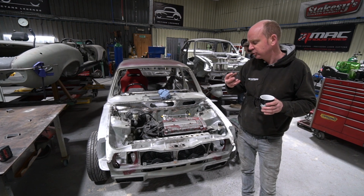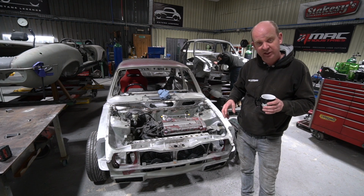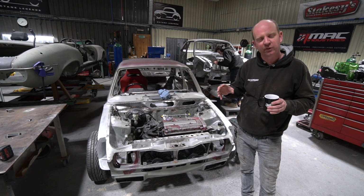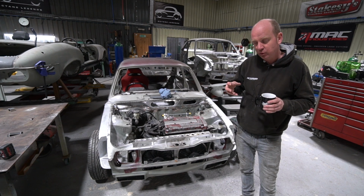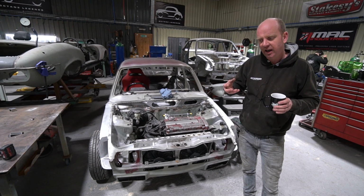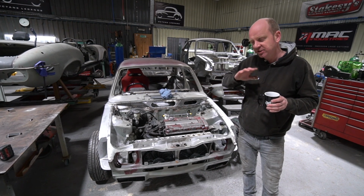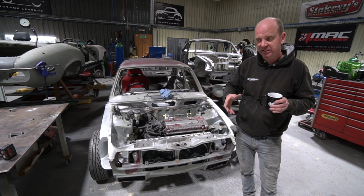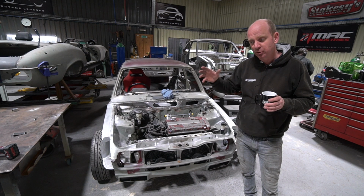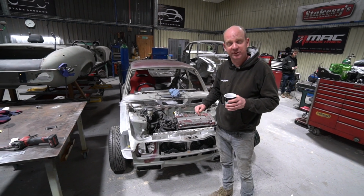At the moment we tend to try and use straight sections of hose and quite a lot of aluminium fabrication to work out one and two off coolant systems. But if we can use 3D printed mandrels and make probably one hose set plus a couple of spares for a project car, then that's a really neat solution. It gives the customer spare parts for the future. We've got the parts to fit to the car, and it all looks like an OEM, original manufacturer part. Really good. So yeah, that was a very beneficial visit for both of us, I think.